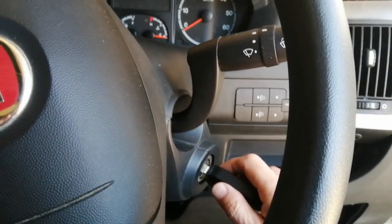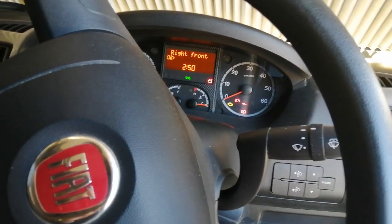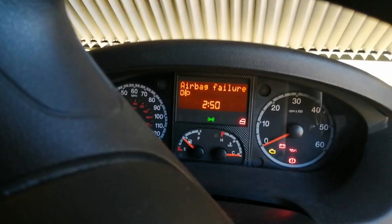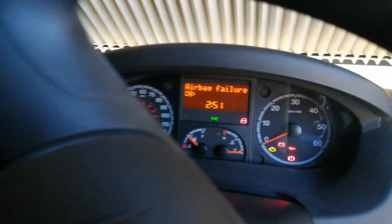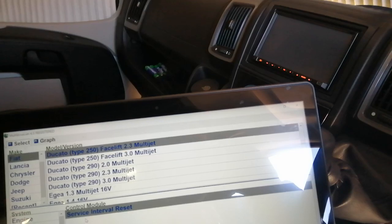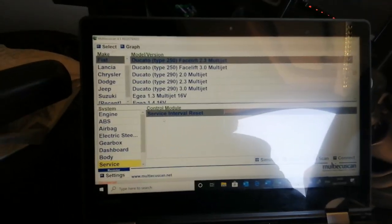So without further ado, let me turn on the ignition. I have to turn that on so that it can power up the modules and read the details. Get rid of that beeping and you'll see the airbag light is on, and it comes up with the airbag failure and says go and see the handbook. Now what a lot of people have been doing is disconnecting the airbag ECU — it's down by my feet near the vehicle battery — and sending it off to a company to have all the errors cleared, which I think is £72 with postage. Hopefully by me showing this tool, that could save you quite a bit of money.